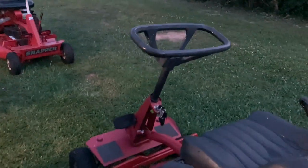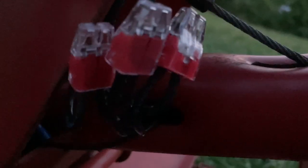The M wire from the bottom of the key switch goes to the coil — the magneto wire. I hooked it right there, connected with tape and a connector. For running the wires, I pulled 12 gauge wire — it's stiff enough — all the way through a hollow bar tube that runs below my seat. I pulled all four wires through that little hole right there in that hollow bar.